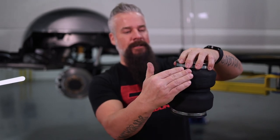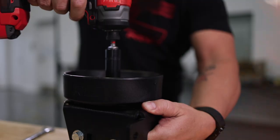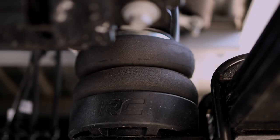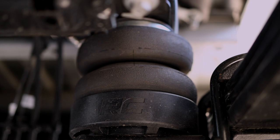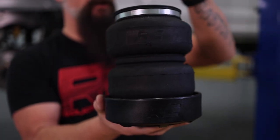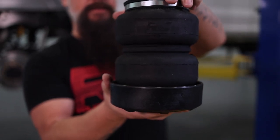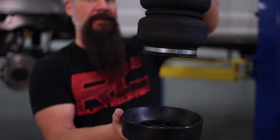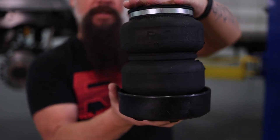That is to say, your suspension is only going to drop as much as this air bag allows. But when you replace the lower mount with the air spring cradle, the air bag sits in the cradle when it's in use. If for some reason you over-articulate your suspension — either off-road, by jacking it up, or putting it on a two-post lift — since the lower is floating, it will simply come up out of the cradle. Your suspension can cycle fully, and then it returns to the cradle and is ready for operation again.